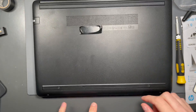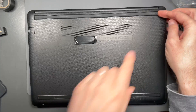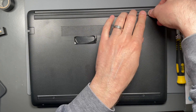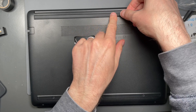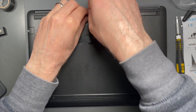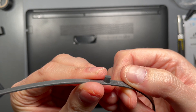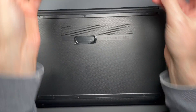On the top there's only one screw down here. There are little plugs underneath, and I'll show you once I remove it. We've got to go very slowly on the top, because if you go quickly and you pull against that plug, you'll just rip the thing apart. I would recommend keeping your finger over this to minimize any translation of this strip to ensure you don't rip it. There are the plugs — if you go really fast, you might tear it at those points. The strip's removed.